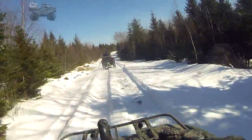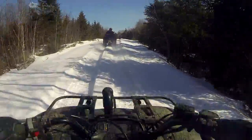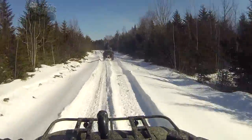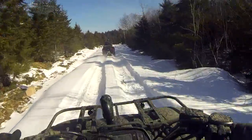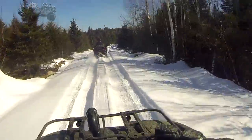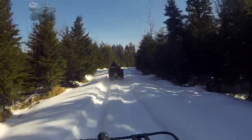I'll tell you, this old girl's gonna need some work. These bushings are getting pretty sloppy, again. But last time when I replaced the bushings up here, like I said, I never replaced the bushings down below. There's a little bearing that's into the frame for the bottom end of the steering shaft here, and that's what's worn out. And because that's worn out, it wore out the other bushings up top here again. So I got a list at home of the stuff I gotta do to it.